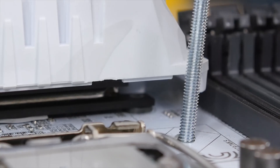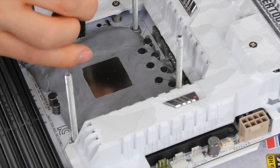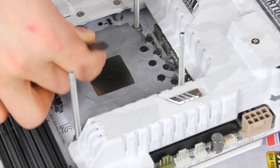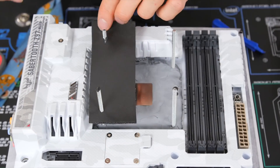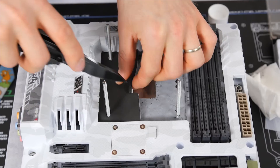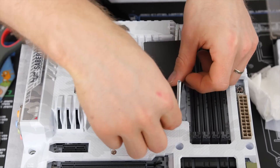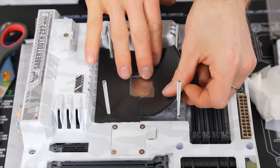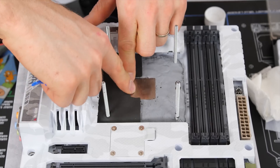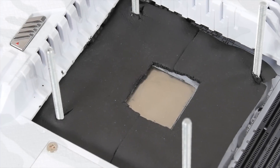On each bolt use a plastic washer then a steel one, followed by a nut, and tighten them up nicely. Now it's time to build up the art eraser on the front until we're almost even with the top of the CPU heat spreader. Go slow, focusing on eliminating pockets for air to get trapped in. You can use a small poking tool to fill gaps. Once that's done, apply a layer of ArmaFlex neoprene adhesive insulation and you're pretty much good to go. There are a lot of different schools of thought when it comes to socket insulation, and this technique is not actually the best one but should be fine for the temperatures we're aiming for. If I was doing something more extreme — like a two-stage or even three-stage phase cooler, or dry ice or liquid nitrogen — I would add some shop towels between the eraser and neoprene, direct some airflow at the socket, and even consider filling the socket pins with dielectric grease. That's gone out of fashion lately due to RMA concerns since it's almost impossible to clean out, but it undoubtedly improves safety at extremely cold temperatures.